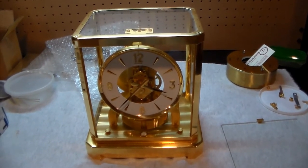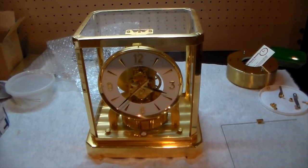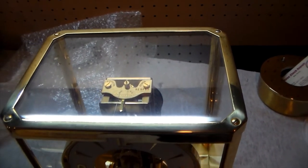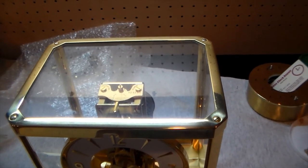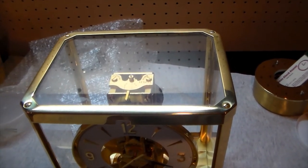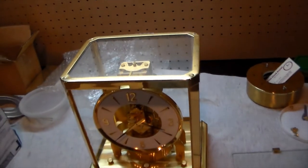So you want to just use a damp rag, lightly damp, carefully cleaning the glass and the case and the case posts. On the 528-8, this top is a lucite plastic — it's like a plexiglass — and with that one you want to be very careful because it scratches very easily. Most often they are scratched already, so you don't want to have any dry rag or any sort of abrasives and little dust particles on that because you are going to scratch it all up.